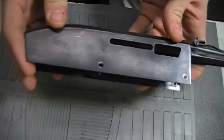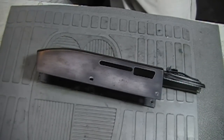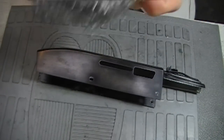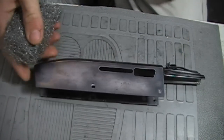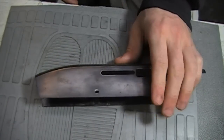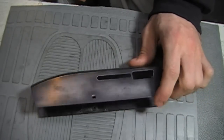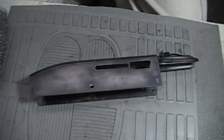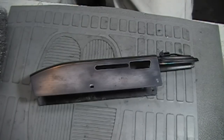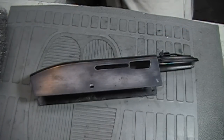After you make your assessment, the first product that I start off with is a very coarse steel wool. The reason I go with a really coarse steel wool is it's going to take off all the residual rusting fairly simply. And again, I didn't notate this, but I'm also going to be using a 1500 grit automotive sandpaper too.